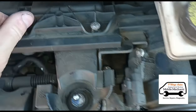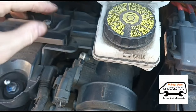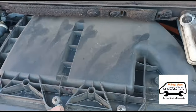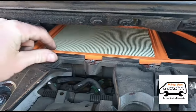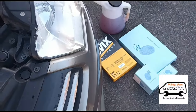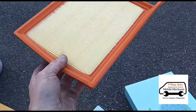Once all three of those are loosened up, on this particular model over here there's another little clip — just get your finger in there and pop that off. Now we should be able to lift this up and hopefully get it out without removing the whole air box. There we go — put your hand in, lift out the air filter, and chuck out any big debris. Here's the Blueprint air filter with the part number.